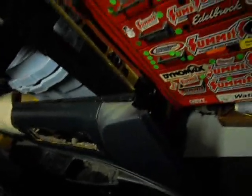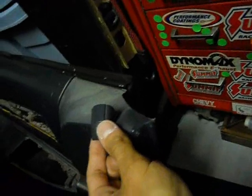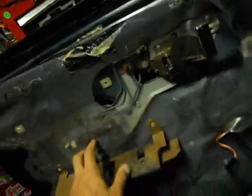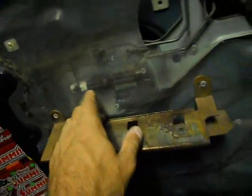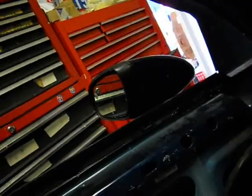Okay, we're taking off the mirror. We got two tens I think, right over here in these 91-94 styles. Still got a crappy factory speaker - should really change that. And that's your door panel. I'm almost thinking that these little caps over here have not faded too bad. So if I can color match that shot, it might be able to give me that SEM paint so I can paint that faded spot. They're kind of faded by the armrest so I might leave that off. Yeah, that's a new door lock actuator - it's going to fix my problem. Let me get this mirror off, I would like to paint it.